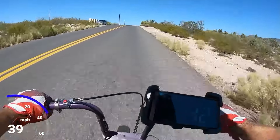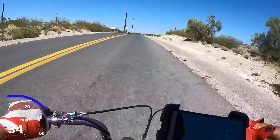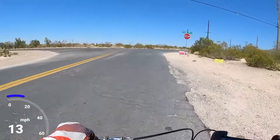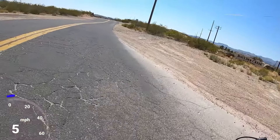We're pretty much topped out right there at 47.51 top speed. You can definitely tell it doesn't like that 95. So we've got a baseline of 4.93 zero to 30 and 47.51 top speed. It definitely doesn't like that 95 main jet.